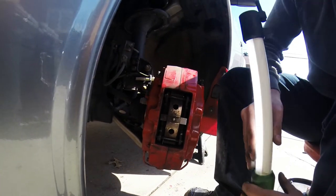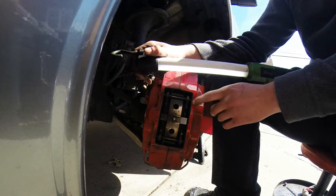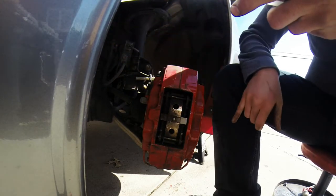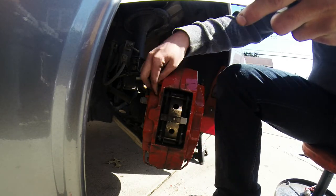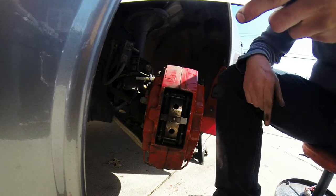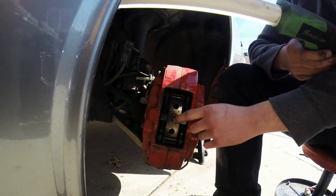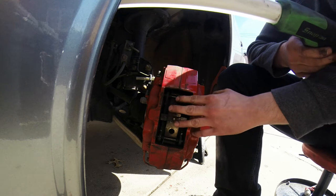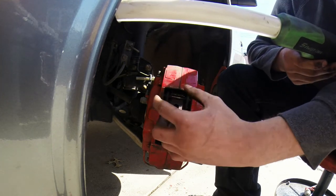So this is the brake. This light ain't doing nothing. Alright. Two pins hold these in. They're going to get punched out in this direction, towards the car. This is a spring tension spring. It loops over. So really you can knock out this one. Spring comes out and this one comes out. The pad's going to pull straight up.